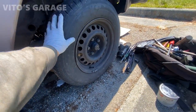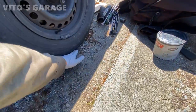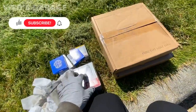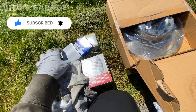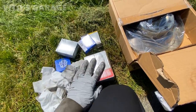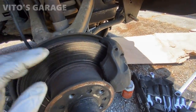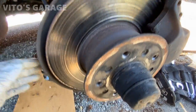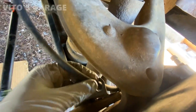The car is jacked up on jack stands. We're gonna start working on the front brake system. I'm replacing the brakes — got new rotors, wheel seals to re-grease the bearings, caliper repair kits, new pads, and new brake hoses. Also noticed something: it's missing a grommet — that's a big safety concern because the hose can eventually rub through without that rubber grommet. I'll need to get a new one.